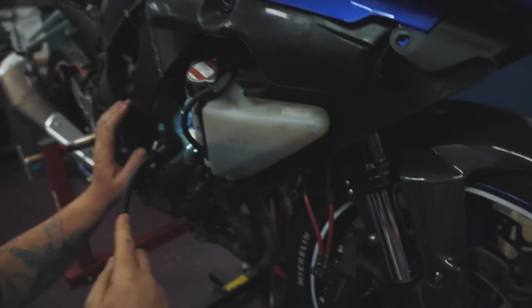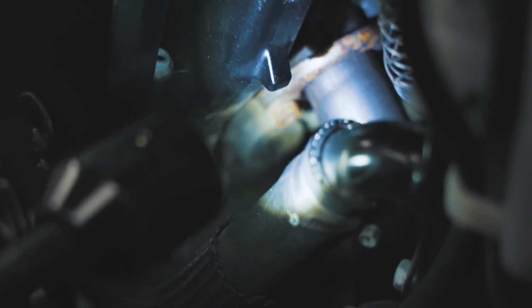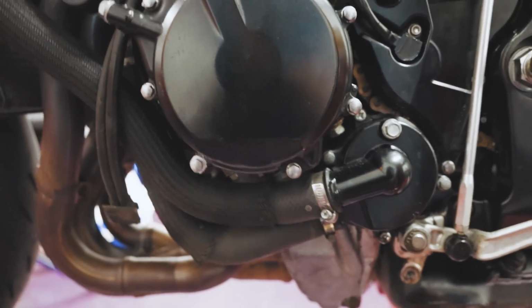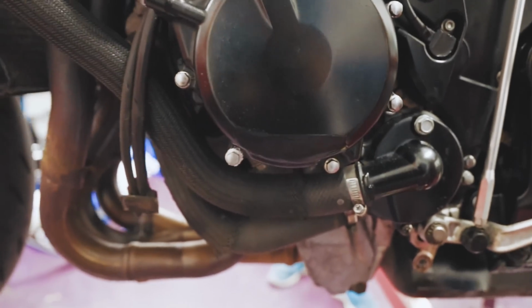So we've got the fairings off. First horror has been unveiled. Some rotten bolts which are going to be fun to get out. They're going to need to soak for like a year. And the other thing, which I hadn't realised when I bought the bike, is it's actually been crashed. A nice bit of filler here. Someone didn't bother even to rub it down.